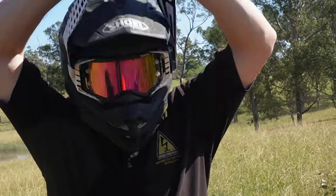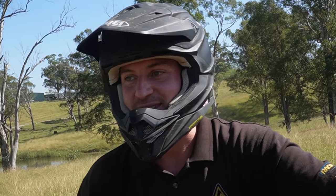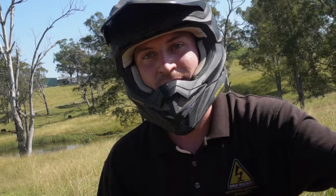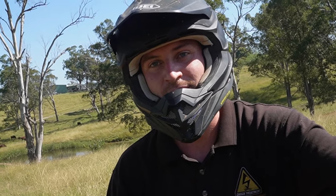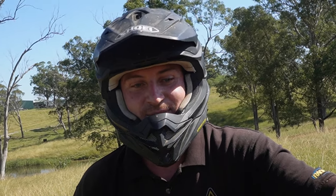How did we go? Good — tiny bit more bottoming resistance. It bottomed out once, off one of the flatland jumps and into a gully with some bumps. It just felt like it rode a bit low. Because we've eliminated a lot of friction, we're obviously going to use more of the stroke. What oil volume did you put in the outside chamber? 380. Let's go to 385 and maybe 390, and we'll see how we get on. Back to the workshop.